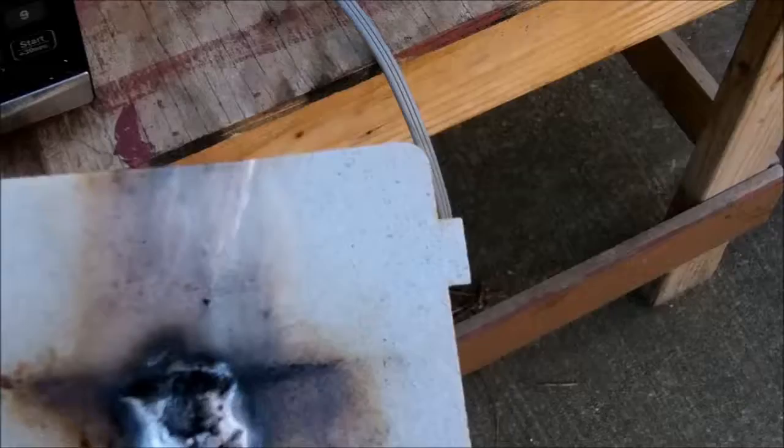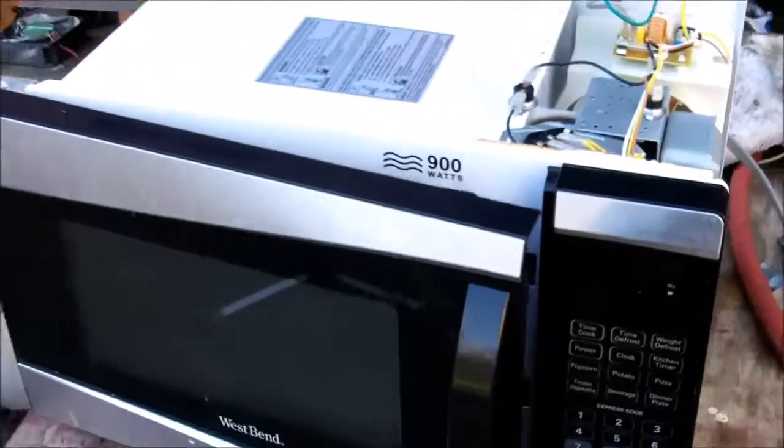so just have a look behind. Oh, I got the piece of cardboard cover off. I wouldn't say it's cardboard, it's like paper, laminated stuff, high voltage, high temperature insulation. And if you look in there, you can see where the magnetron's right up here, and the waves go down at an angle, and it's all burnt in there, so I guess this one won't be getting fixed.